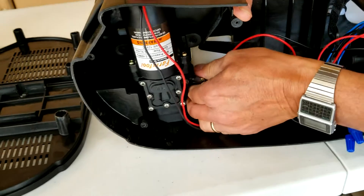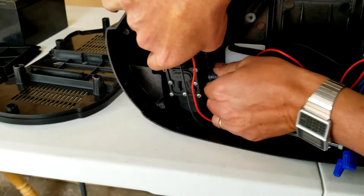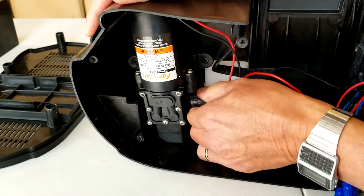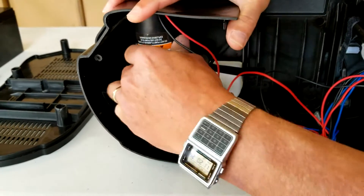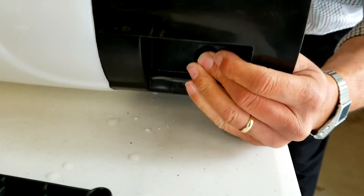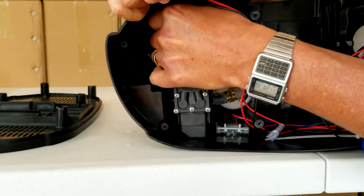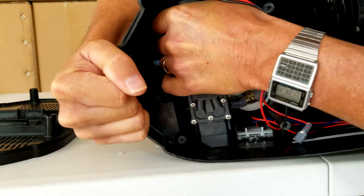You see how that comes off. This is a thermoplastic, so if it's too hard to pull the motor out, you can always take a heat gun to it — it makes the elbow a lot more pliable. The way to get it out is to push the threads through the hole. It takes a little bit of work to pop that out.